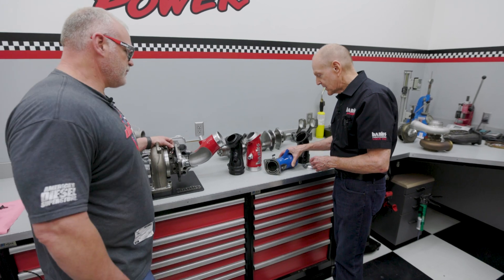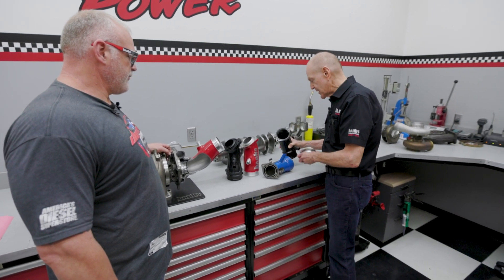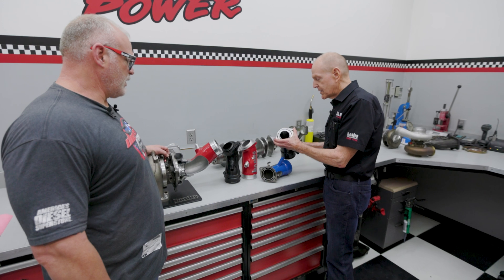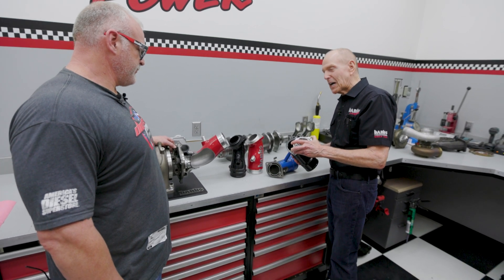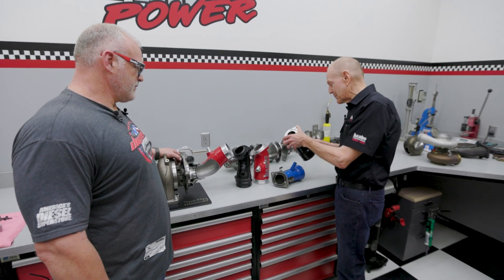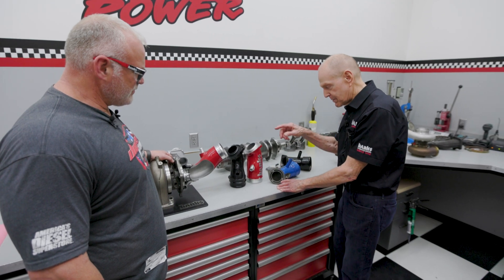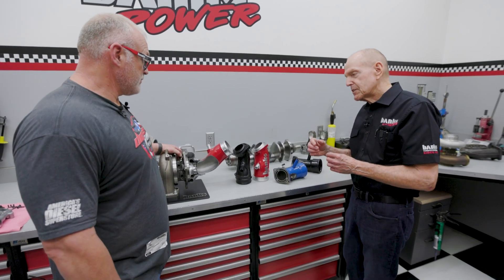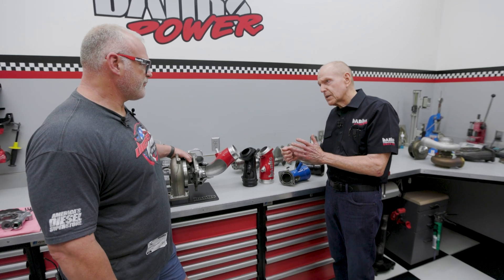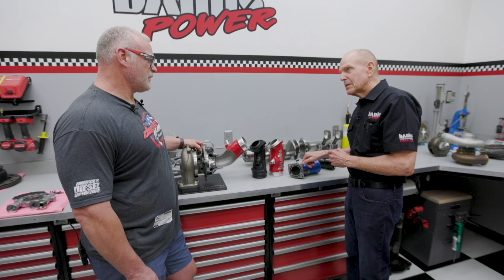To fix that competitor product — and this is really funny — the guy who makes it has a customer, Duramax Tuning I think is the name, who cuts the offending material out and makes a sandwich spacer to emulate that gap. This tells you right there that the original product doesn't work — a fix exists and people buy it because they're stuck with the first product, things surging and carrying on. Some of these other guys who make air horns for the L5P say you can tune around the surge. Well, one way to do it is to just not make as much boost where you're rolling into the throttle — but that's counterproductive. You're taking away power to band-aid the fact that this thing is wrong to begin with. And then they want to sell you a calibration to go along with it.